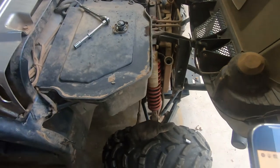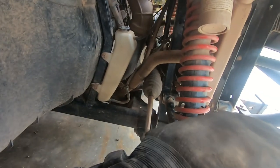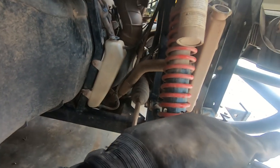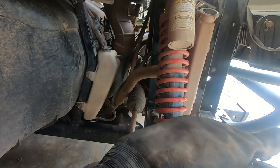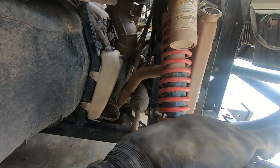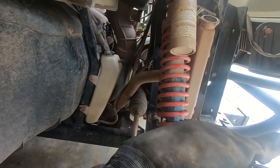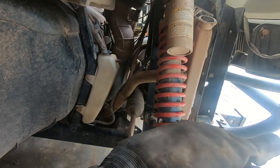Another person mentioned having a collapsed radiator hose, where even though the water pump was spinning, the radiator hose was old and soft and would collapse on the side under vacuum toward the water pump. You could also have a clogged air filter — I would think that would cause a rich condition, but maybe it would be overheating not just because of rich or lean, but because the engine's just struggling.